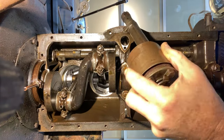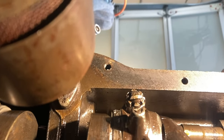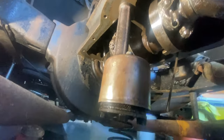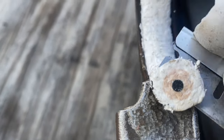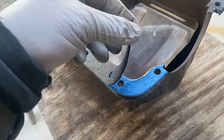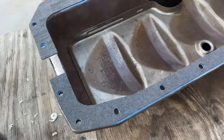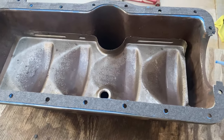Here's the oil pump going in. Here's that oil pan rope seal just getting a little trim. I like to use silicone when I'm putting new gaskets in — first of all, it positively locates the gasket and doesn't allow it to slip. And it fills in all those little imperfections.